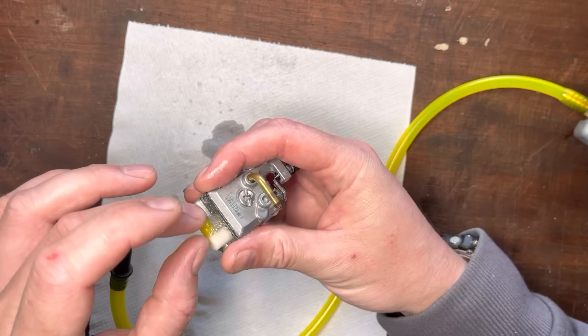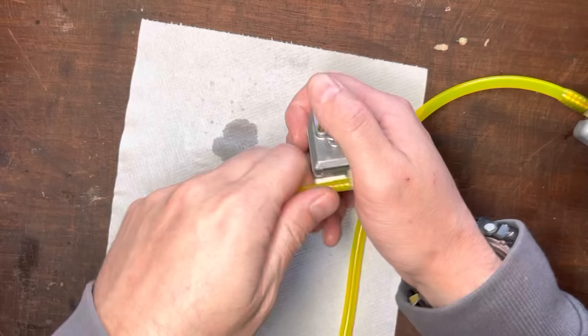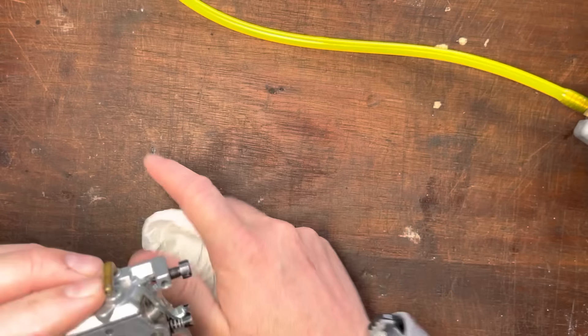We can see it straight away — there's a leak coming out from where the hose connects to this barb, and you can actually hear it. Now this hose is on tight, so I would suggest there might be a small crack. They're kind of notorious for that. It probably won't be the end of the world running it like this, but it's only going to get worse.